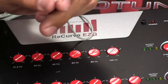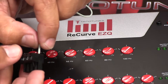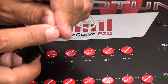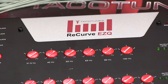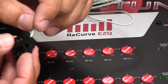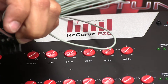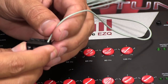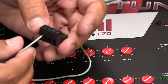So I'm going to cut away some of that excess wire. Then I slide it into the connector — still a little too long. I want the jacket to sit right inside the connector. After trimming a bit more and tightening it up, you can see I've got no bare wire showing whatsoever. The connector inside is making contact with the wire itself and it's not going to touch another wire — that's a good connection right there.